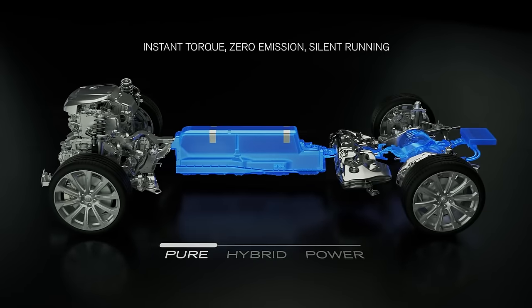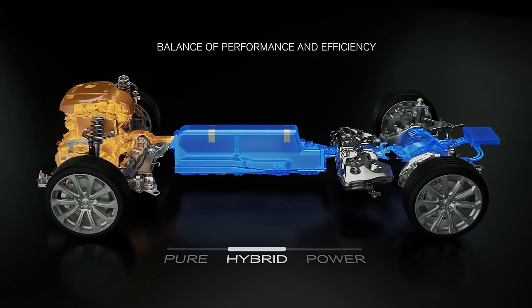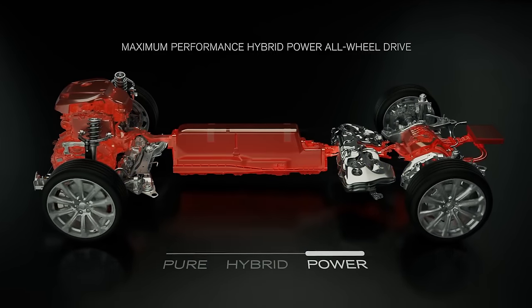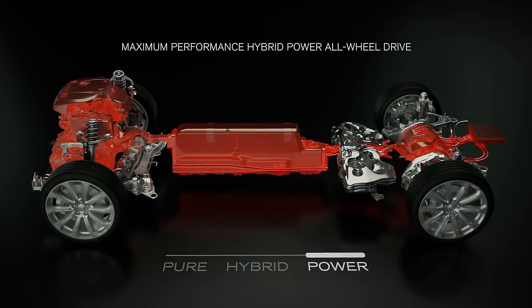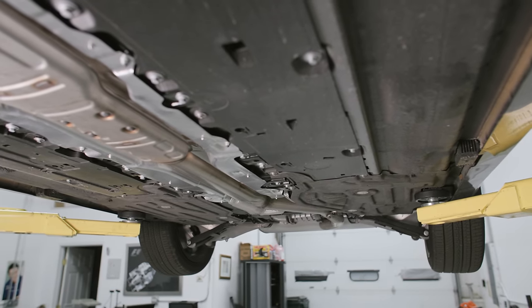They had so many software revisions to fix how the front talked to the rear, the electronic pairing of the rear motor, and handing off power from the supercharger to the turbocharger — it never felt right calibration-wise. For the late-model 2022s and 2023s, they've made revisions: they've dumped the supercharger on the T8. Now you're dealing with a two-liter turbocharged engine making about 315 horsepower and 295 lb-ft of torque, which feels far more seamless. It does require premium fuel. They've also upgraded the battery pack to 14.9 kWh, giving you about 40 miles of EV-only range.